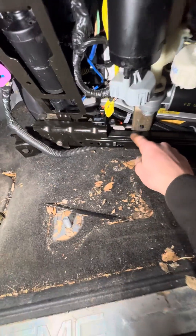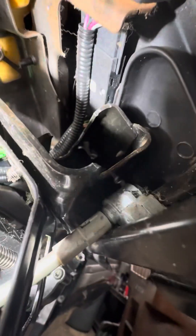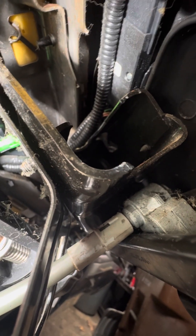If it doesn't move, the track's bad. On this one, the track is bad. When I did this side — there's the gearbox — you take that off, you can spin it by hand and see which track is stuck. This side is good.